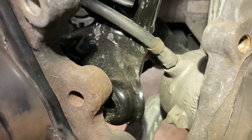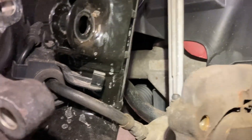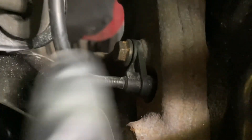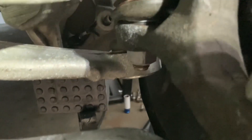The knuckle is moved out of the strut. Be careful — the suspension arm bushings may be applying a lot of torsion. The whole knuckle wants to move up because at full droop the strut is pushing it down. Going to unclip the bracket and move the brake caliper to the front, then undo the 10mm bolt for the wheel speed sensor and pull that out. From there we should have room to access the two control arm ball joints — there's one there and one behind — and those are also 21mm, probably needing the ball joint separator too.